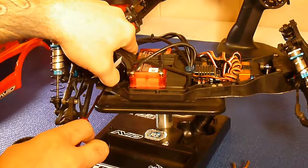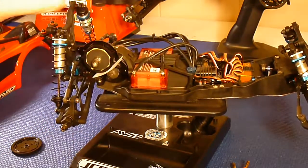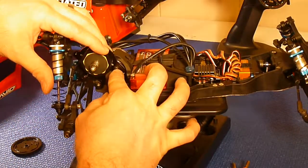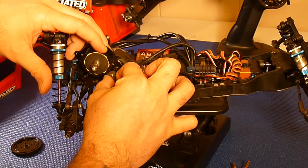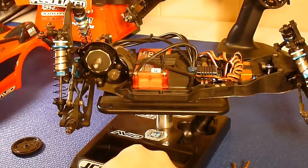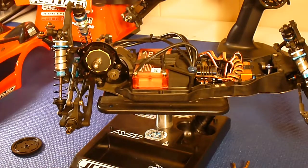Tighten it down — make sure it stays tight. Then, how I know it's in there good is when I pull the paper out, it shouldn't rip — it should pull right out. And you'll notice if I hold the spur still, the pinion will still move a little bit. That way you know it's not too tight, because if it's too tight you can lose power, and if it's too loose you can lose power. You want it just perfect. Just use a little sheet of paper, cut it real small, stick it in there, push it tight, tighten it down. Simple — easy way to gear mesh.